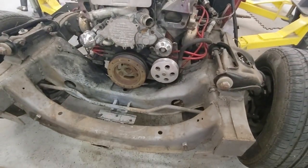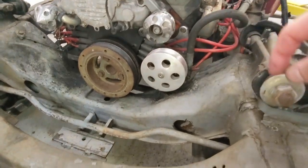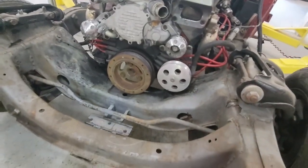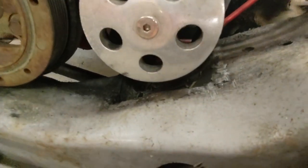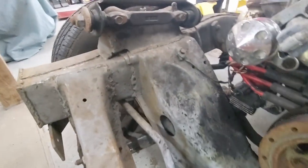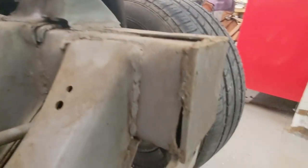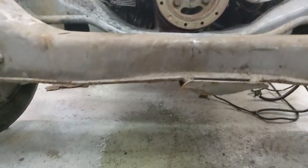Progress so far: you can see we've got the radiator out and we're starting to get some of the front end components off. We don't have to take everything off. Next is probably going to be wiring and electrical. We definitely got to get the power steering lines out. Some interesting things about this frame — somebody has scalloped the frame to account for this. There's a little bit under there that's done, and that's pretty close. We'll have to see on the new motor if any of this will have to be further modified. It also looks like we've got a little room for improvement on some things. I might come back and clean these up in a couple spots — somebody boxed this off, but it would just be a good idea to come in and seal this up where possible. Most of it looks pretty good, though.